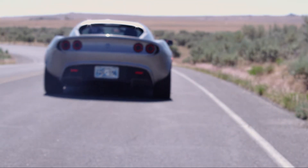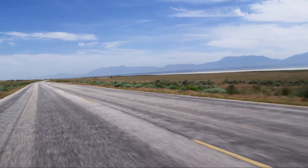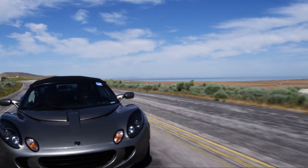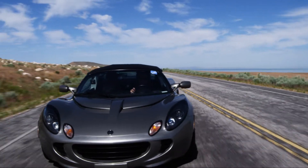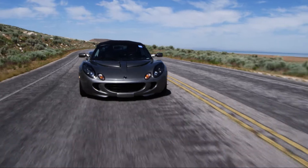The car is cited with a 0-60 time of 4.9 seconds, and if you can get a good launch at sea level I can definitely see that being a distinct possibility. You definitely get more of a shove from that second cam profile that comes on at 6,500 rpm. The gearbox is a six-speed; the weight of the shifter knob itself actually really helps guide you into each slot. The linkage on this car in particular is a bit loose — it has 65,000 miles on it, which for an Elise is considered high miles. There are a couple of things to nitpick: the shifter linkage and the brake pedal feel, which is not as tight as I would like.